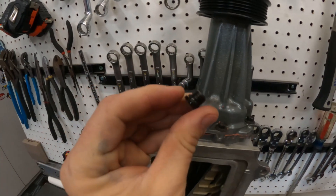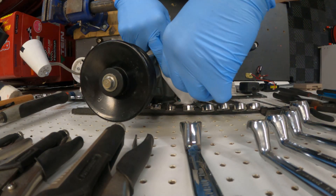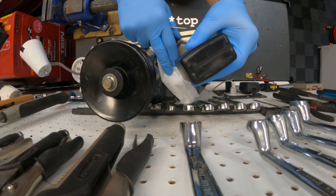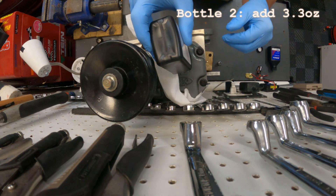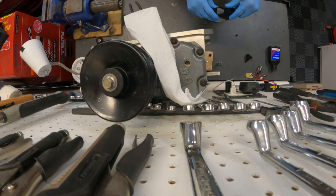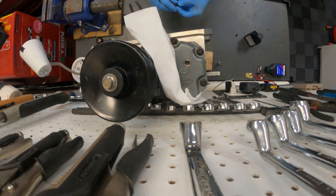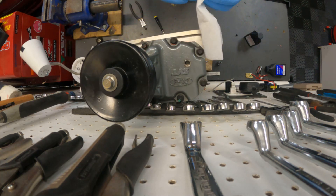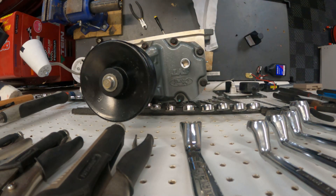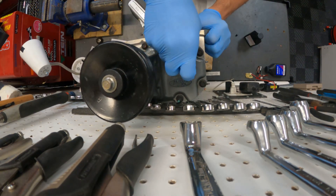Make sure your fill plug has the little O-ring on it. Just poke a hole in the side of your container and it will flow freely out the bottom. Save any remaining fluid in case you need to do future maintenance. Take the fill plug, make sure it's cleaned off, and thread it on by hand. I don't have an exact torque value but I want to say it's about eight foot-pounds — just give it a snug tighten, don't overdo it. Set it flat and monitor it for oil leaks over the next day or two.